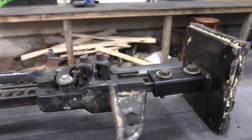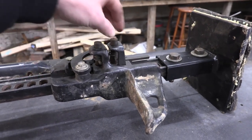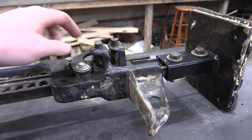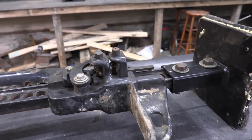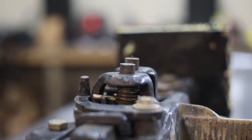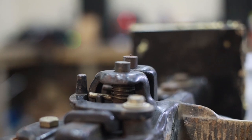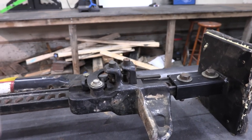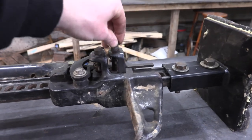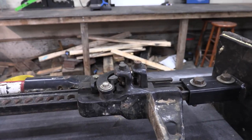The first thing I want to talk about when it comes to safety is making sure your jack works. Put it in neutral position and pull both of these — you can see that both return springs work. If these climbing pins get wedged when you're in the middle of using the jack, you're going to have to use unsafe practices to free it up. Make sure they're clean of debris; every once in a while take an air nozzle and spray them out.